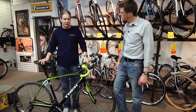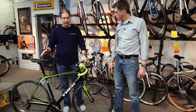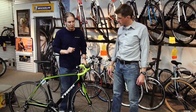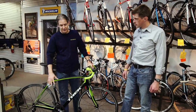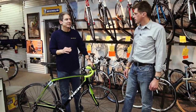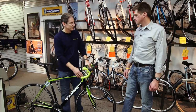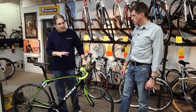After that happens, we can then at least set someone up on a test ride and get them riding. What we're ultimately looking for in the reach of this stem can be covered in a different video at some point, but it's going to help determine the top tube overall picture of this bike. But to at least be sure that you're not some extreme difference from inseam to torso, we want to make sure that this 58 centimeter bike has, based on my torso measurement, at least somewhere close to that 57.5 top tube, which we spoke of with my torso measurement. Yes. This particular bike does. It comes into that 57.25 top tube. Okay. So we know this is going to work for me.